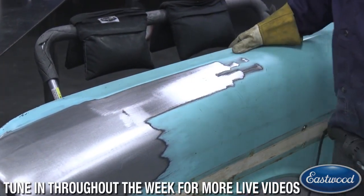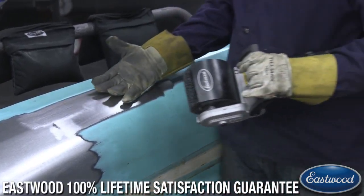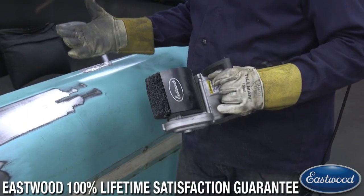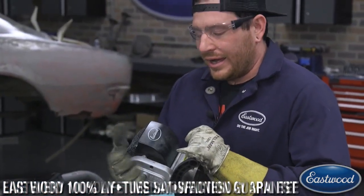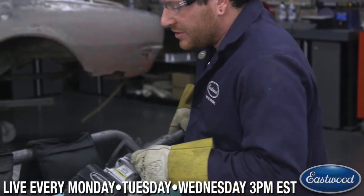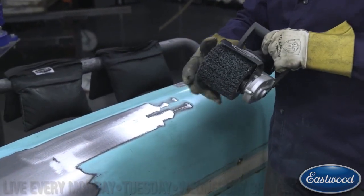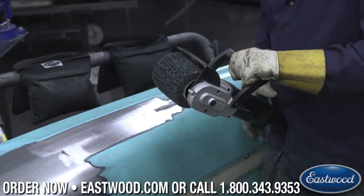My answer to a lot of people that ask that question is it's just like any tool — if you sit in one spot for too long and abuse the panel, yes, of course you could heat this up, but you notice I keep moving. The other thing is this actually has metal gears in it — it doesn't have a belt, so it doesn't slip. You can see some of the times when I'm pushing into it, this isn't stalling the tool; it's letting it dig in and giving me feedback.